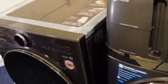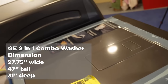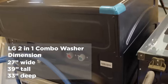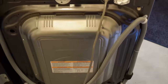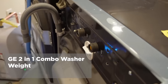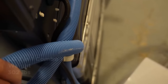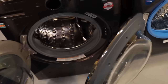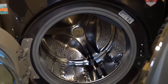Let's talk size because it could affect anything you want to do when considering a unit. The GE is a bit larger at 28 inches wide, 47 inches tall, and 31 inches deep. Comparatively, the LG is 27 inches wide, 39 inches tall, and 33 inches deep. At the front, the GE has a more curved glass on the door, which protrudes slightly more than the LG flat door, but at the rear the LG's metal cover bulges out quite a bit. Weight-wise, the LG is significantly lighter at an estimated 246.9 pounds, while the GE stands at a net weight of 302 pounds. I could personally move the LG via a dolly, whereas the additional weight of the GE prevented me from moving it easily. Both are heavier than a standalone washer of a similar size — for example, an LG washer is about 190 pounds net weight.